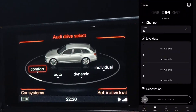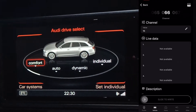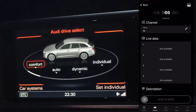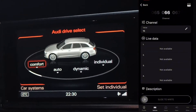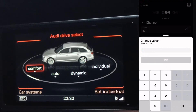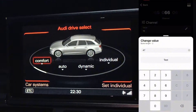Here you have the value. From stock, in my situation, you're going to have 15. It's a good idea to remember your stock value if you want to come back to it later — you can do that without any problem. Press the pencil icon to Edit, delete the current value, and type 47. Please watch the screen as soon as I press Test.